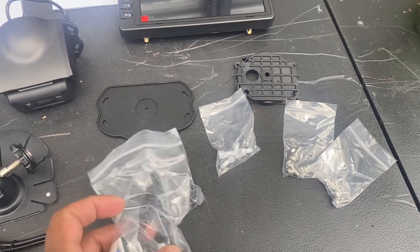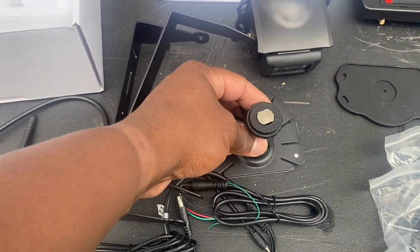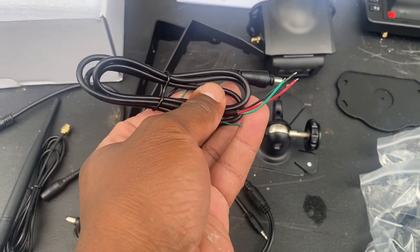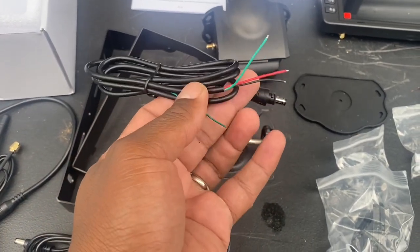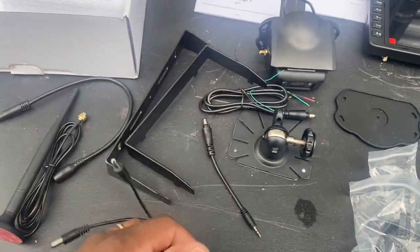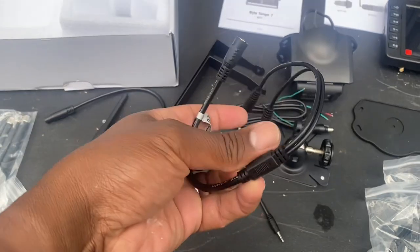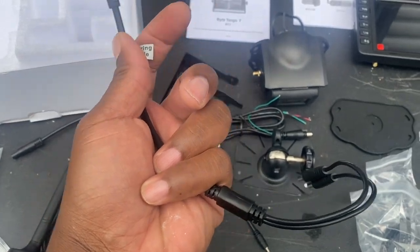You have some more 3M tape. This is to hook up your monitor to your dashboard — it has 3M tape, the strong type. Here's your connector — this is what you're going to use to connect it to the back of the camera and the back of your RV. We have to splice those wires a little more. It comes with a green wire — we're not going to use that, so we're going to cut that back. This is your 12-volt plug outlet if you want to power it that way. They do give you this double outlet so you can connect it to a power source and check the camera and the monitor at the same time.